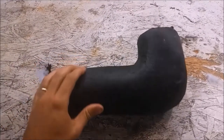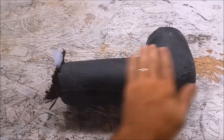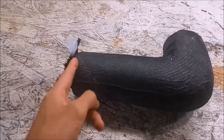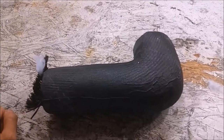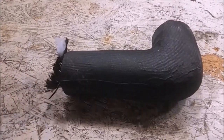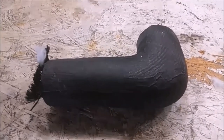Here's the product of the vacuum bagging process. We have a few wrinkles we'll have to sand out before giving it one more coat of epoxy, just to give it that shine that's normally associated with carbon fiber parts. Then I have to cut each end and basically destroy the mold inside — that's really the only way I know how to do this. But the mold release wax and the PVA will make all those parts pop right off the carbon fiber.